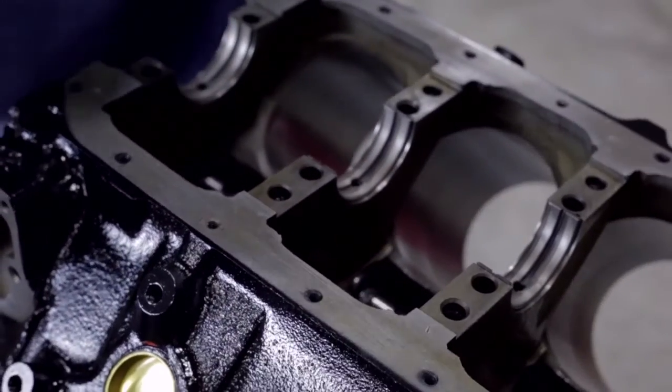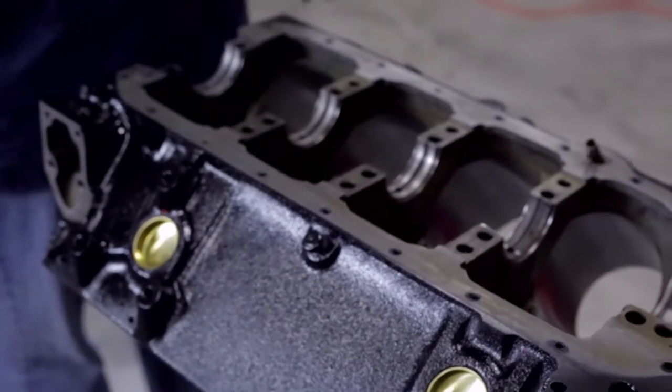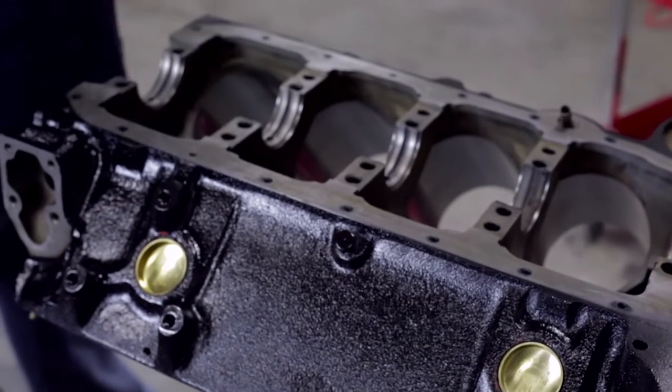You can see we've got the rest of them installed. Remember this is a dry fit — we're not oiling or lubing anything yet. We're going to lay the crankshaft in and just check our clearances, then take everything out, lube it up, and do the final install.